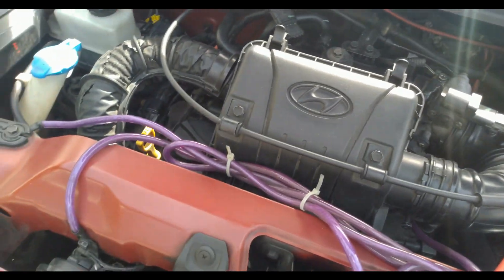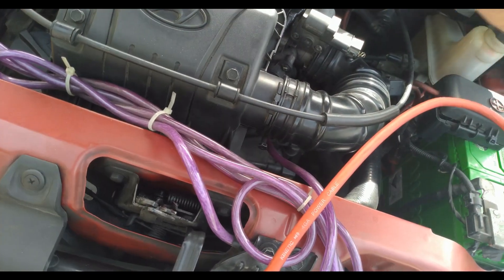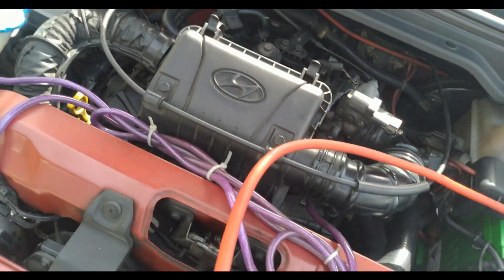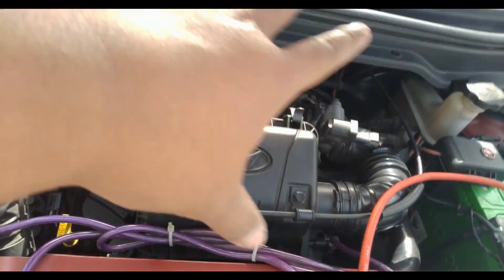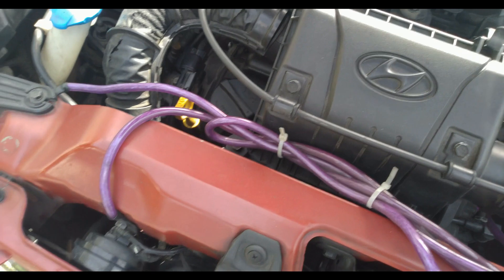I have a six-point grounding kit — five wires go to the negative ground and one goes to the positive on the alternator. I actually removed one wire, making it a five-point kit. I'm going to disassemble everything and use one single ground wire with ring terminals installed, like this one, and install it in the engine bay. I'll remove the HKS aftermarket one.